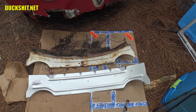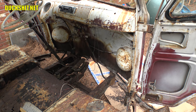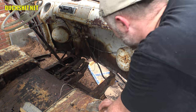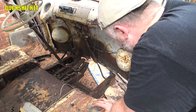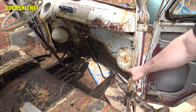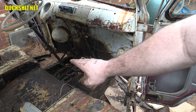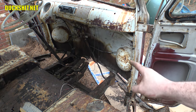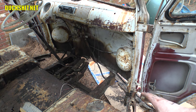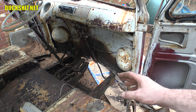Let's look inside the bus and assess the rust in there. I really like having that light in there — it makes a huge difference. Looking up under here it looks like it's all surface rust except for the very bottom, which is buzzy and misshapen — that's where somebody had done some repairs. All of that looks to be below the V of the nose, so I think I can cut about a straight line an inch below that and replace the entire piece. What I think I'm going to do is rip out the wiring harness — it's just in the way.